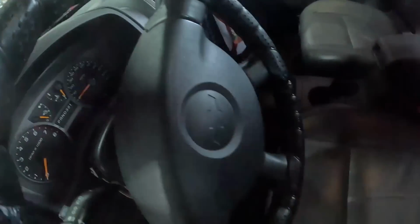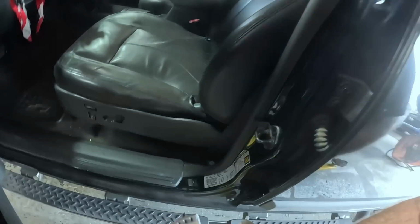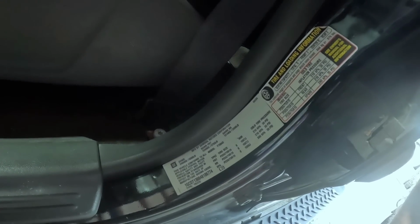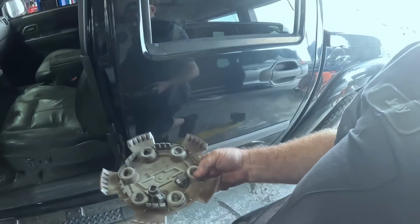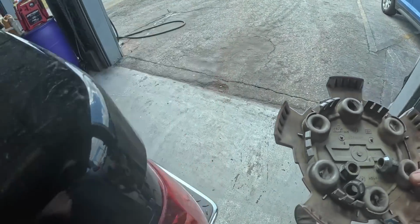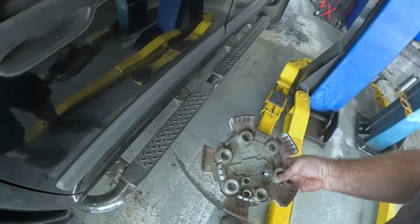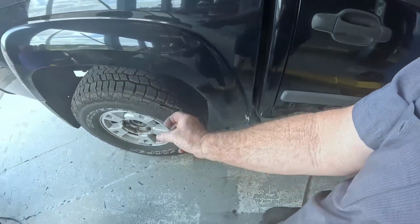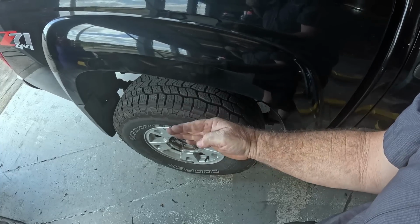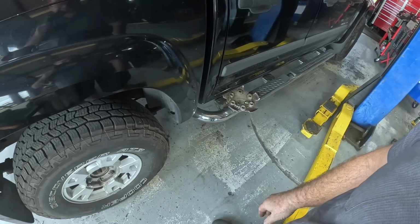304,232 miles. My love rating is 7. Truck's actually in really good shape, 304,000 miles. 2004. We drove it in with Bill watching the wheel to make sure the axle wasn't going to slide back out on the way into the shop, and it went the whole way without moving out. It came out a tiny bit, but not enough to jump out of the bearing. As long as the axle shoulder stays in the axle bearing, that distance is what you have to work with if you need to do that in a pinch.